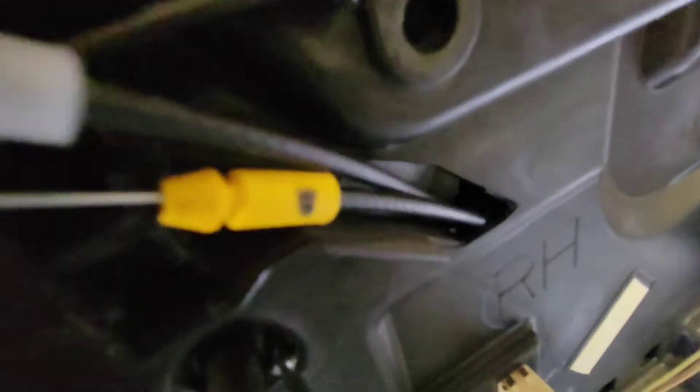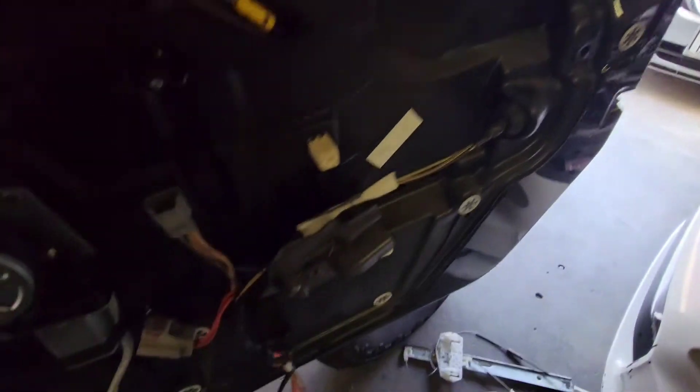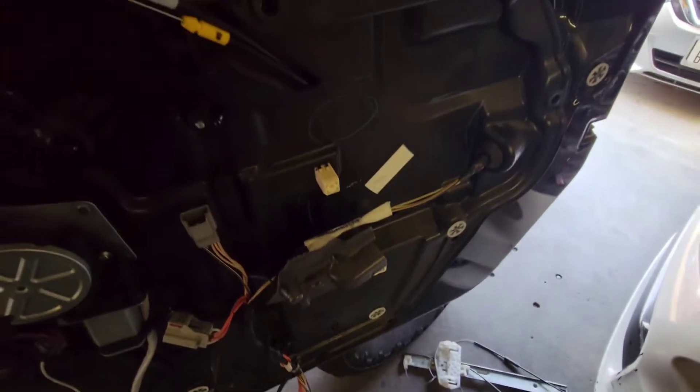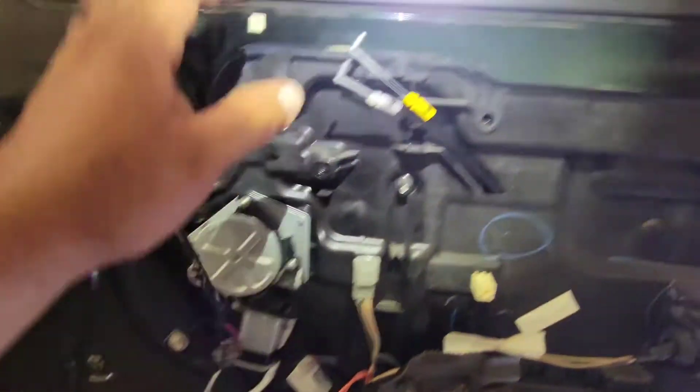The window is going to sit right on that plastic clip right there. What you want to do is pass these cables through here and through the back. There's also a pigtail we have to plug in right back in here, so we'll go ahead and plug that in. Pass our wires — we're going to get both of these window regulator metal brackets inside, then we'll start bolting it down. Make sure we plug everything back into place because we won't be able to get this off.